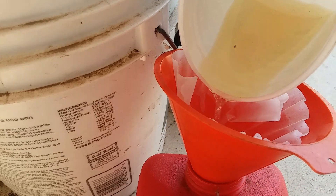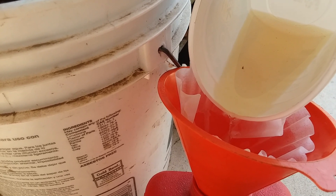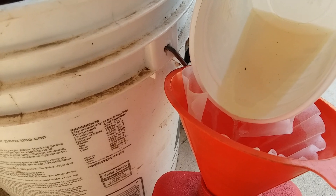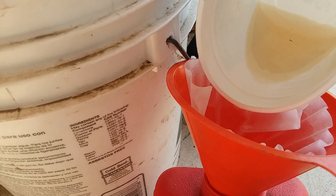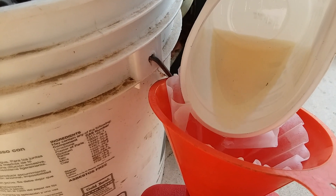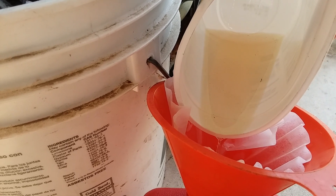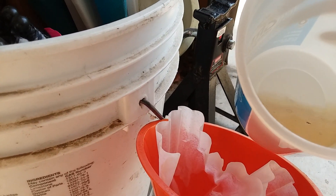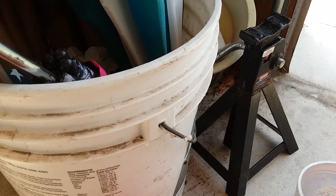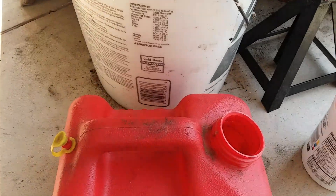You don't want to dump this straight in. See how that moved — we're going to cut that off before it actually starts to enter the filter. It'll separate pretty quickly even if you agitate it. Once you get to a certain point you can't really get it out unless you go to a smaller container. Basically we've taken probably 90% of the usable fuel.